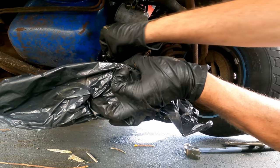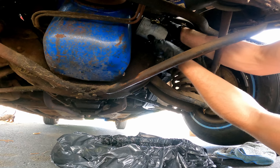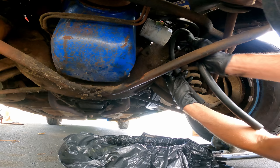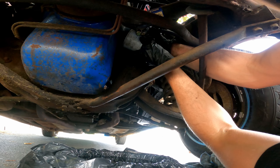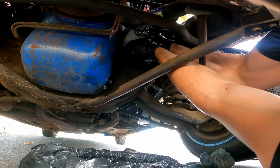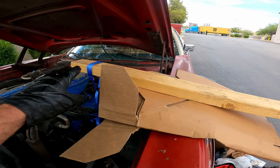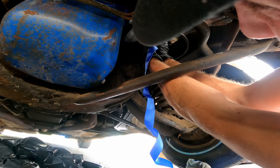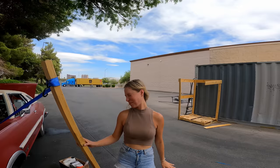Gus, you got to get out of here. Let's see if I get lucky on this oil filter. She probably should have got a wrench. How about the hose trick? We got Jen up top, hose wrapped around here — she's going to pull it and then slowly seat it onto the filter, just give it a steady pull. Last idea — I got a ratchet strap. She's going to put this board down and use some leverage. Couldn't do this on a modern car. That worked good — that was a tight filter.